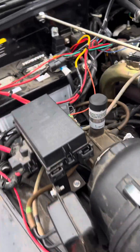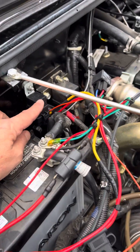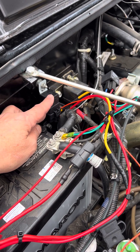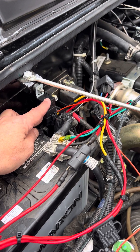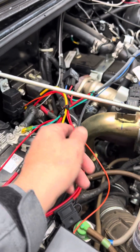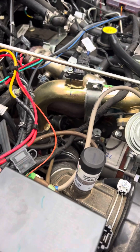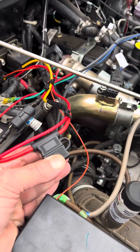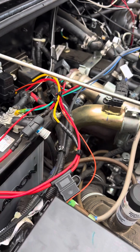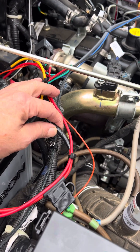Over here is the electrical side. The install kit comes with this relay and a number of wires that come out of it. You get a wiring diagram, but I actually had to call Diesel Freak and talk it through — and I do have some background in electronics. This yellow wire is the power wire, which comes back to the battery. In the kit is this inline fuse, which is actually a loop of wire that you cut to open up. You put a spade tip on one end and fasten it — I chose to solder and tape it.